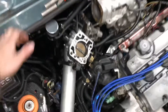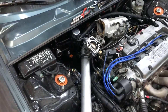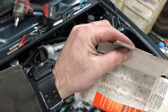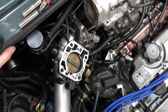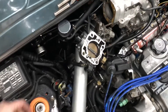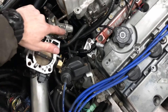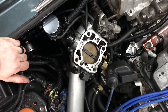What I usually do is take a spark plug box — not a sponsor, but Autolite — and chop out little pieces to make gaskets, because they're really thin and dense pieces of cardboard that work well for high boost applications. I test my system at 30 pounds of boost since the max I want to run is 25 to close to 30. I'm going to make a gasket for the FITV around both ports, probably one piece, so it doesn't leak during a boost leak test.